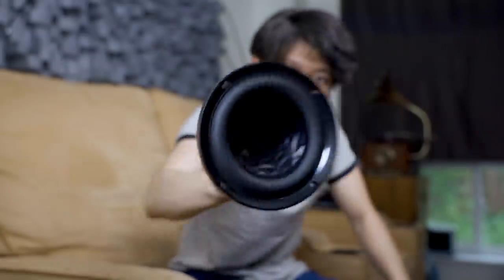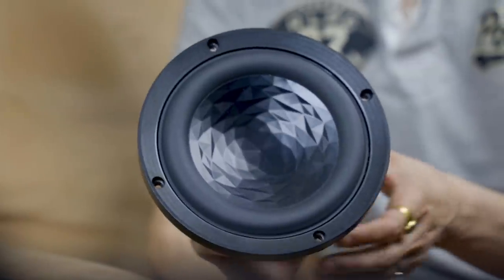This is a six-inch ASXR driver that's inside the Elac Vela. ASXR stands for Aluminum Sandwich Extended Range diaphragms. It has this crystal shape going on that's quite eye-catching, but this crystal shape is more than just eye candy — there's actually a purpose for this. The crystal-shaped inverse aluminum dome is glued to a paper cone in a special process.